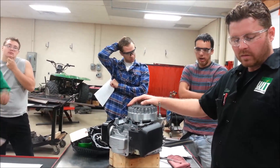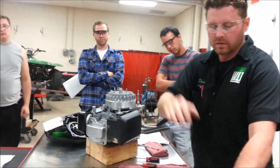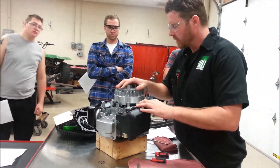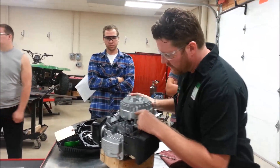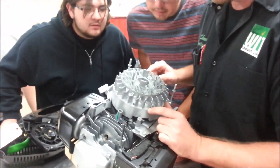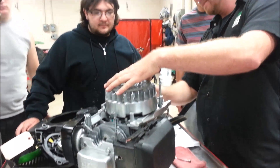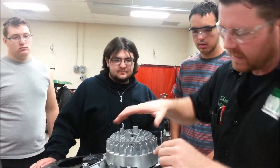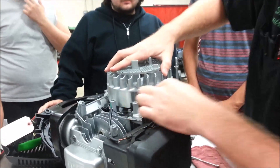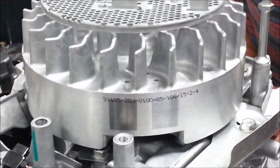A tip: when you're done with an air tool, uncouple it so you don't bump it accidentally. Now, when you go to take yours off, notice on the flywheel where it says 'polar' and there are some arrows. You see the magnets — there's only a magnet in one spot, and it says 'polar.' Over here there's no magnet. We have our magnets here, and here's where it says 'polar,' per a Honda training video.